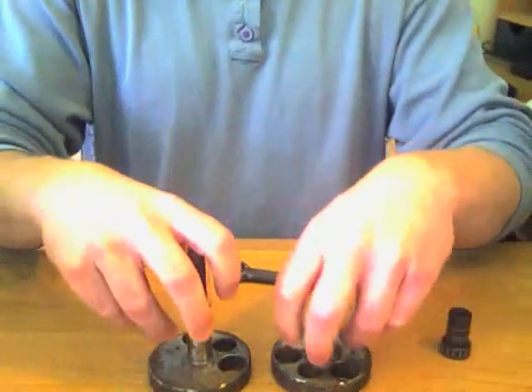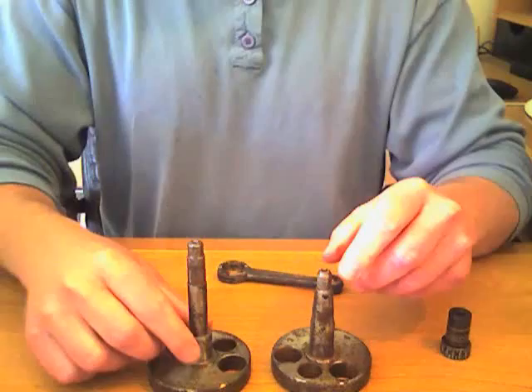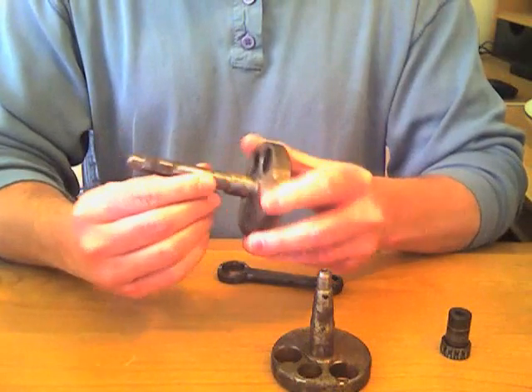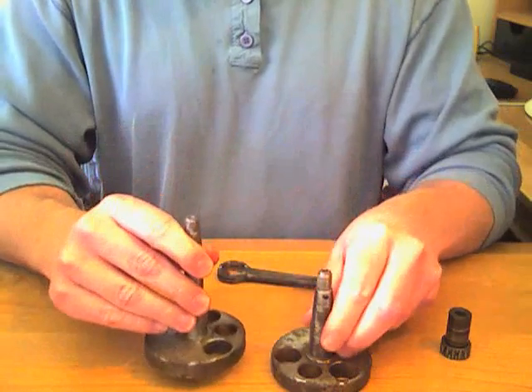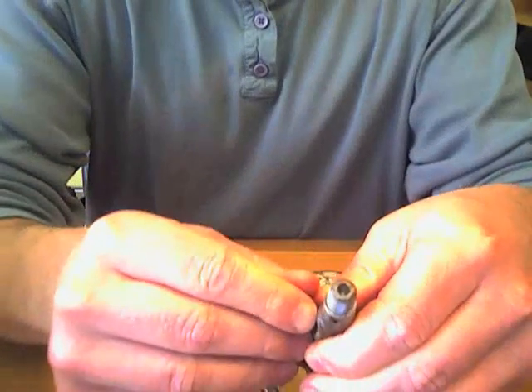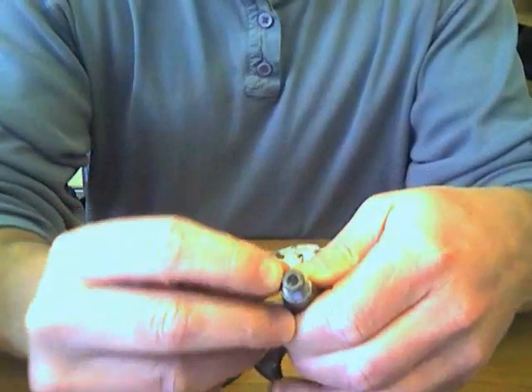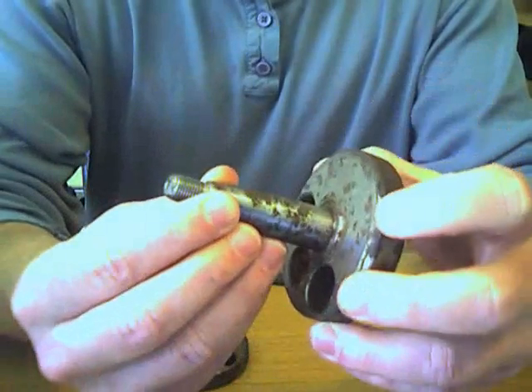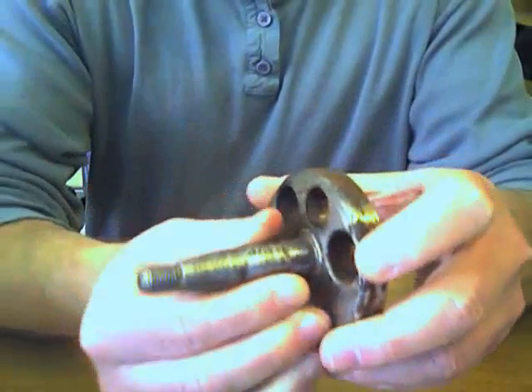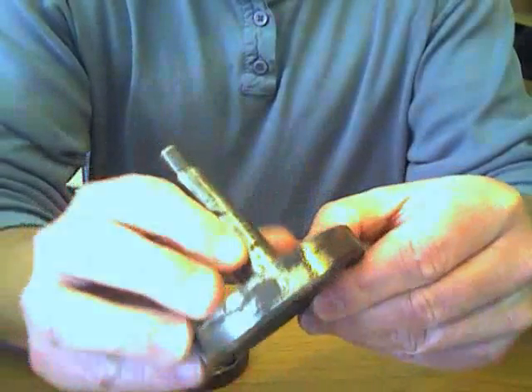The shaft itself is straight on both sides. There's not much wear, but there's quite a bit of rust. The threading is pretty rusty on this side, and there's a little bit of damage done to the very end of this shaft — it's a little bit upset, which happens with very well-used crankshafts, which I think this one probably was.